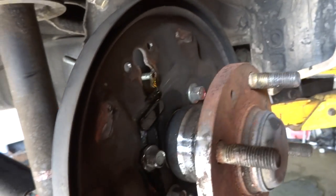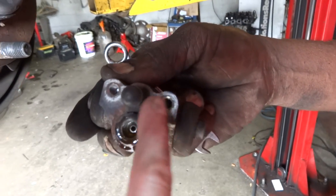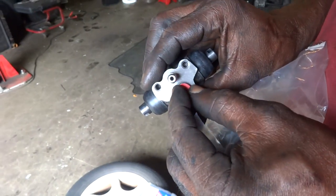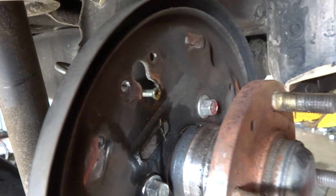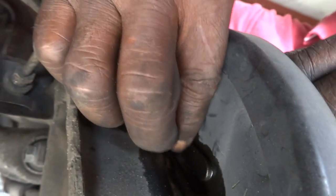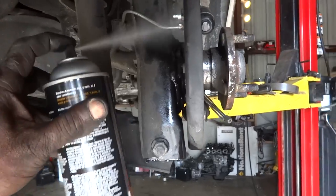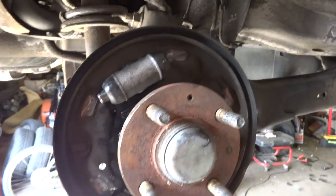So this is what it looks like when you pull it out. You've got a little port in the back where the brake line goes in, and that's the little bleeder right there that we'll be using later to get the air out of the system. There's the new wheel cylinder — just take the plug out and now it's ready to be put right in there. It's pretty much impossible to mess up. Now you're just going to put the two 10mm bolts in the back to bolt it up to the brake shield. After you've snugged those up, snug up the brake line. Then spray a little brake cleaner on here to clean up the brake fluid — we don't want any of that getting on the new shoes.